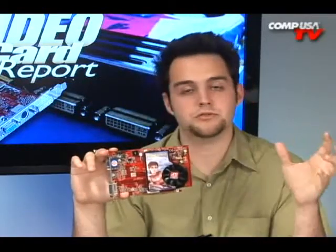Even though it's DDR2, it's very fast memory, and you have a gigabyte of it, which is really going to help for people who are watching Blu-ray movies and HD DVD movies. There's a unified video decoder on the card, and that really removes a lot of the stress from the CPU. Testing this with Blu-ray and HD DVDs, the CPU utilization while you're watching a Blu-ray movie is only about 1% when you have this in your system, because this card is handling pretty much all of the HD decoding. Even when you're watching an uncompressed HD file, the CPU utilization is going to be in the single digits. It removes a lot of stress from your CPU.